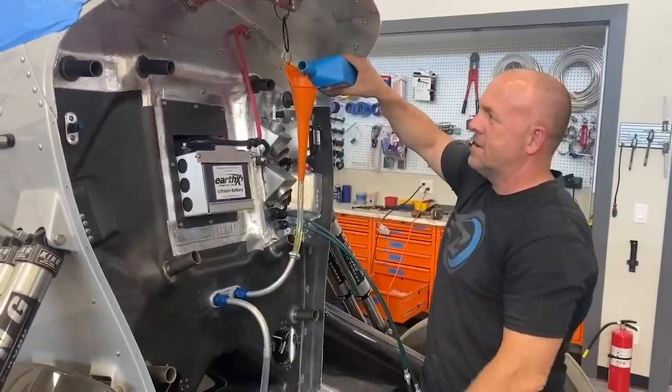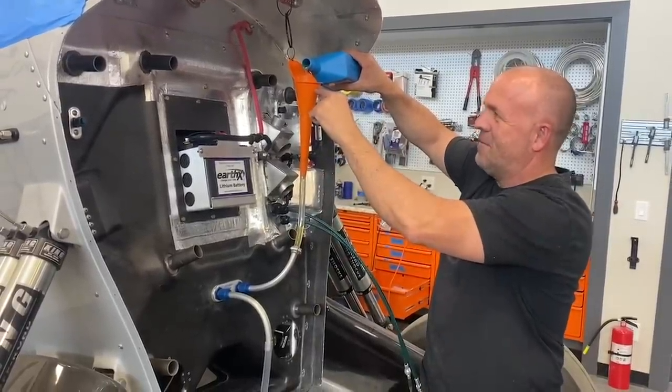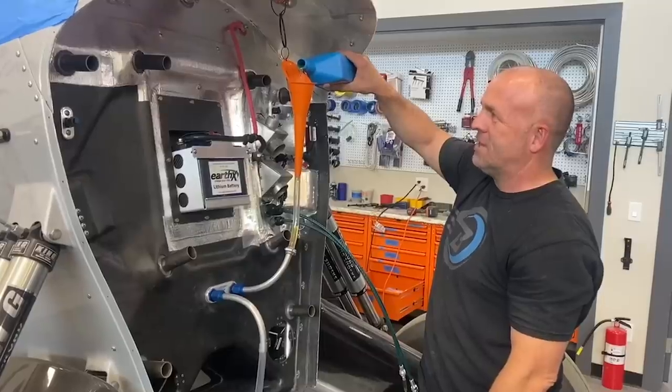I can actually flow oil easier to the back of this plane and back because of the reduction in lines, a single cooler, and bigger lines. It'll flow easier — it's just going to take a while by hand. When that tail is down, the oil cooler will be low enough that it won't drain out. When I change the oil, I'll hook up quick-connects, dump the oil, hook in a quick connect, use a flush-out pump, push it through the system, and when I see clear oil coming out I reconnect the quick connects — a complete flushed-out oil cooler every oil change. Adds two or three minutes but no big deal.